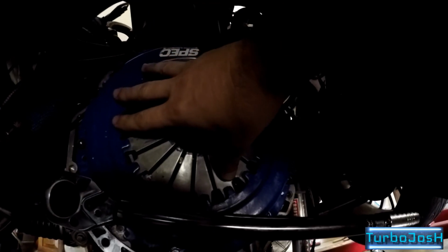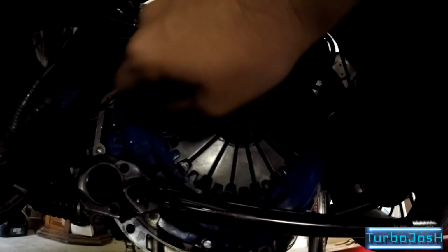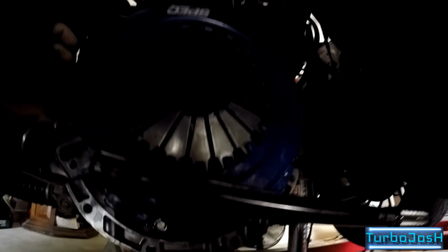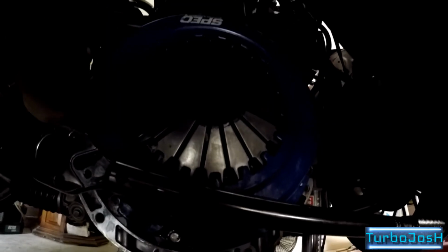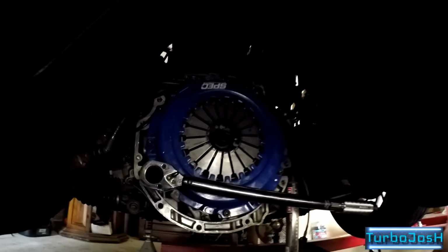So now you have your torque increments for SR20 clutch system. If you don't have it already, if you haven't seen it elsewhere and you were on this video anyway, here it is for you. 14 and 22 foot-pounds for the clutch disc, clutch plate, pressure plate, whatever you want to call it. Flywheel is 33, 66, 92. It's like 94 through 101. I think I did 94, 96, who knows. It'll work, it'll hang in there, and it's just an update.